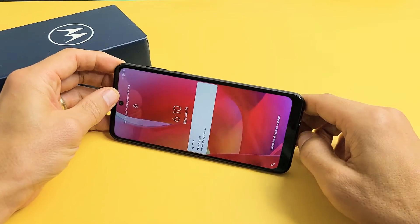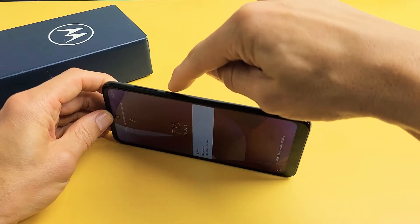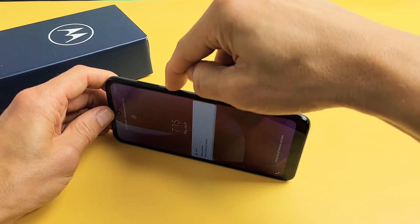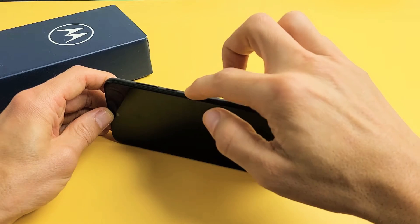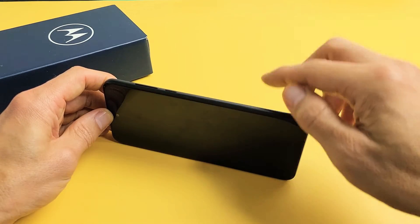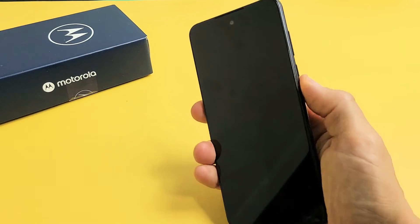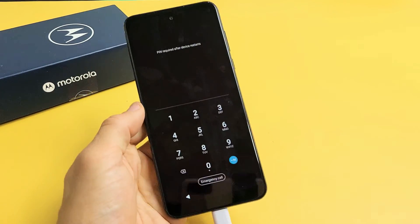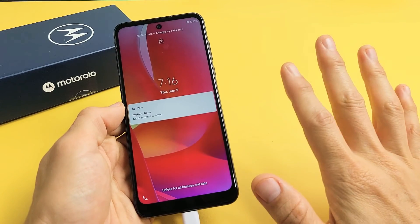If you're still stuck in a boot loop, no problem. Grab your phone and see the power button right here. What I want you to do is press it in and out three times, kind of hard — just to loosen it up. Maybe it's stuck or jammed, or maybe there's lint or coffee or soda in there. After that, go ahead and grab your charging cable and plug it in, then wait about five seconds.